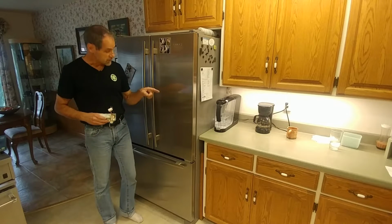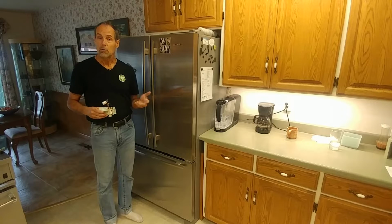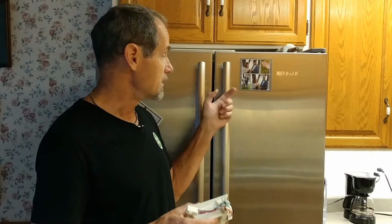If your refrigerator is making noise down there, that's a different problem. It could be the evaporator fan. The fan draws air over the cooling coils below and behind the freezer, up through a channel. When the damper control opens, it enters the refrigeration compartment.